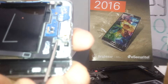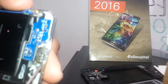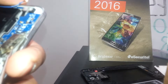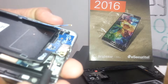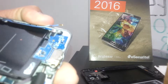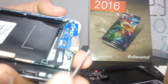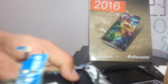Let's figure out which side is better to work from. This side is the charging port on the left — we can insert the screwdriver here. We're going to pop up the metal plate that is protecting the charging port. Insert carefully — it only has glue — so we're going to pop it little by little. Make sure not to fold it.